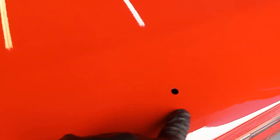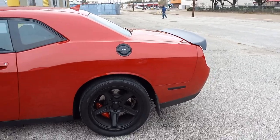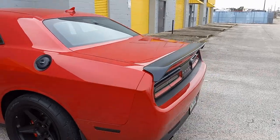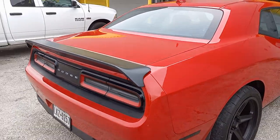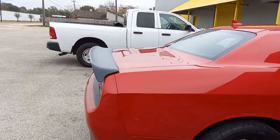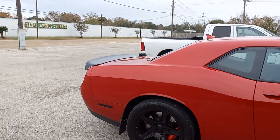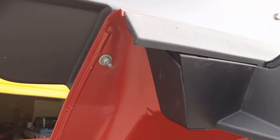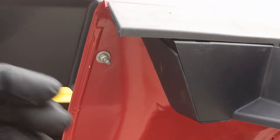Just make sure you cover your holes with some blue painter's tape so that spray doesn't come out and get on your finish, although it's going to be covered with a spoiler anyway — so maybe it doesn't really matter, but it's a step I took. Installation is unbearably simple. If you've made it to this point, installing this spoiler is simply removing the tape protectors off of the tape, taking that red stuff off, lining up the holes, and sitting it down. There you have it — one performance spoiler installed. I don't know of any torque specs for these nuts, but just a little bit of wrench is all you need. Just snug them down.